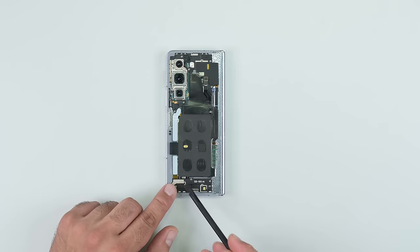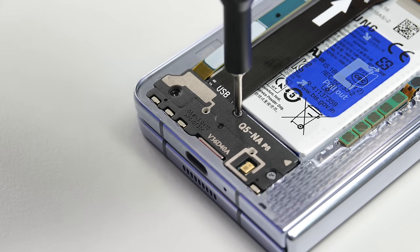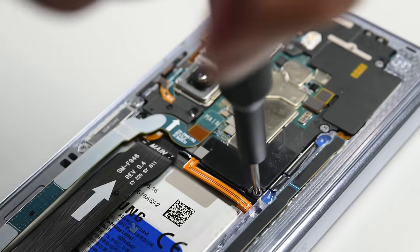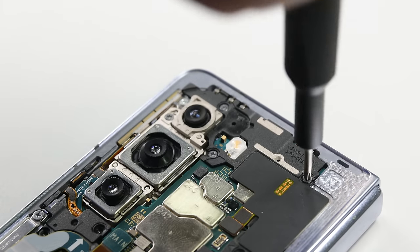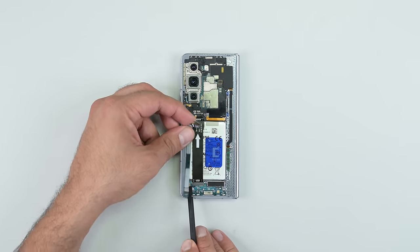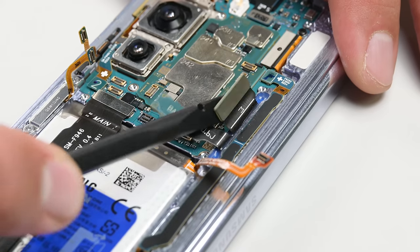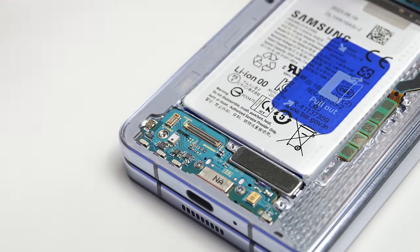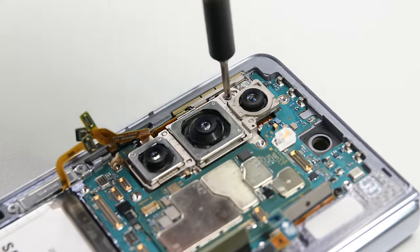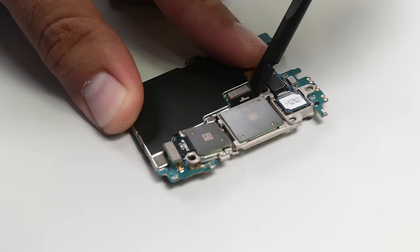Turning over to the other half of our two-part device, let's disconnect that wireless charging coil and get to those screws holding the plastic mid-frames and interconnect cables. There are a few cables here: one is a battery cable connector to the battery on the other frame, the battery cable from this side of the frame, daughterboard interconnects, and the display panel cables among others. The inner front-facing camera comes away easily enough, and it's onto the mainboard and rear-facing triple camera assembly, which comes away as one. Turns out the cameras aren't a single assembly — each camera comes away separately.